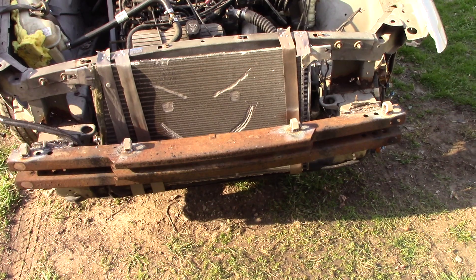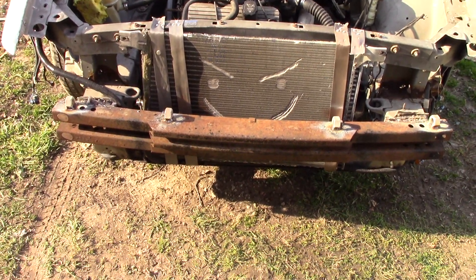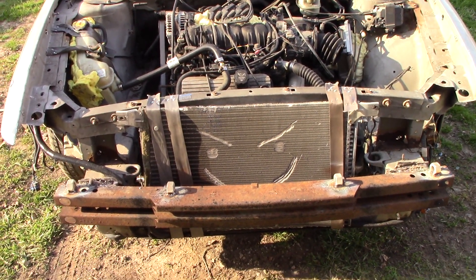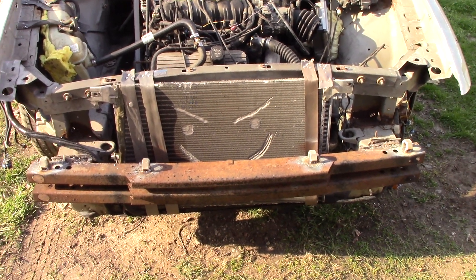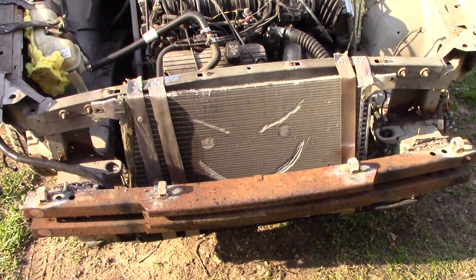We can run pretty much any style of newer bumpers — no chrome bumpers, unless that's off of a factory front-wheel drive car. Pretty much any type of bumper reinforcement is allowed, whether it's off minivans, cars, SUVs, whatever, as long as it's one of those rebar bumpers that sits behind a plastic cover. You can use it for most of the shows around here. So we have welded that on and got it sitting here ready to go for this car.